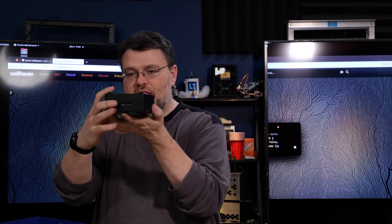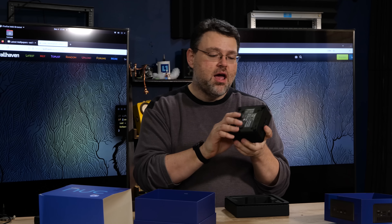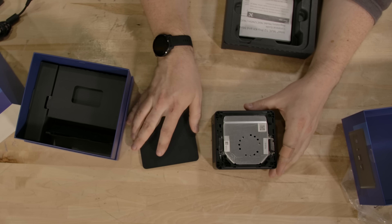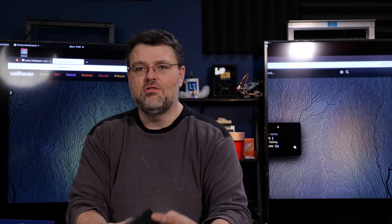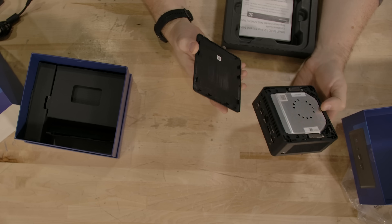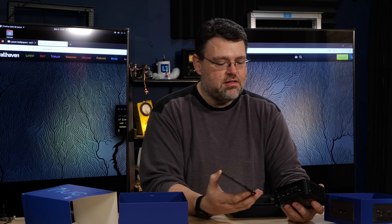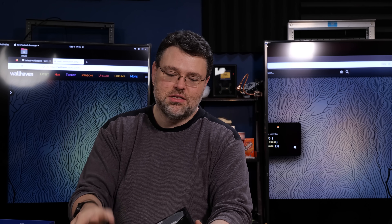This computer is Lilliputian — you're Lilliputing, which is actually the name of the website. At the top they have an optional Qi charger connection that plugs in right there, so you could use this as a wireless charger to put your phone on top. This model doesn't have it because it's the lite version — there's just plastic in here — but there is a connector for it. You can probably get that accessory online. You can see the Wi-Fi antennas, but there's no reason to remove the top unless you're installing the Qi charger.